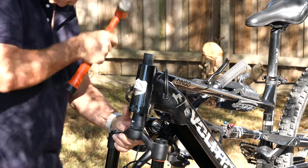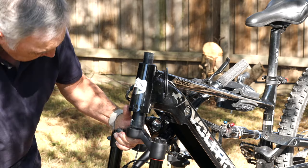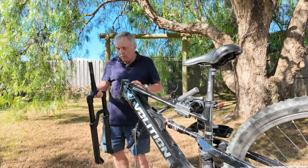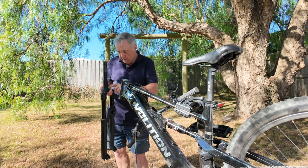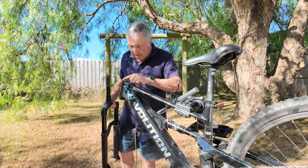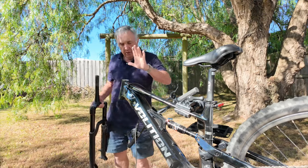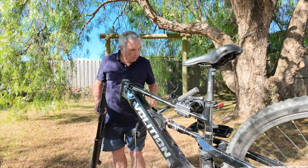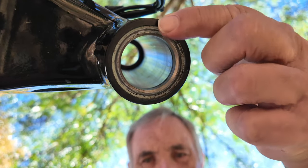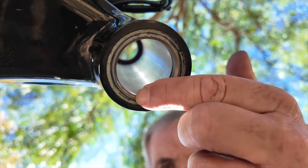You might need a soft-headed mallet and just slowly drop it down. There we go — that helped to pull that top ring out, and now the whole thing drops out. Be careful when bringing it out so the race underneath doesn't drop out. On removing this, we have a split bearing down here and another bearing up here which is nice and snugly fitted — we're not going to move that, it stays as is.